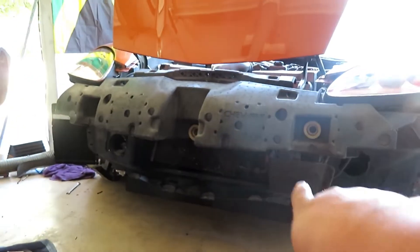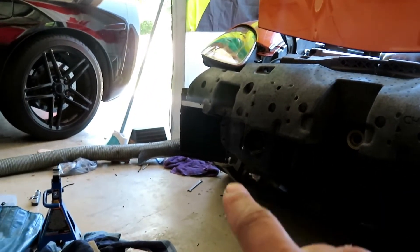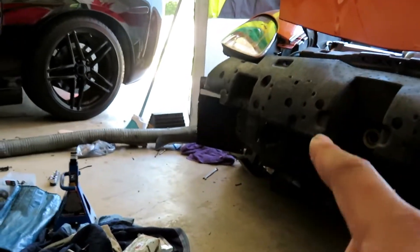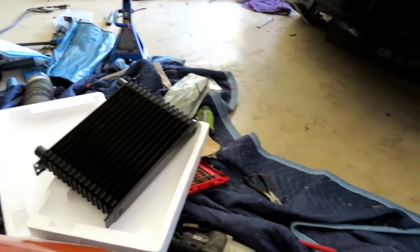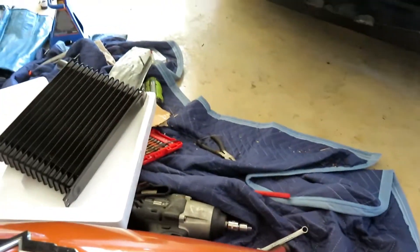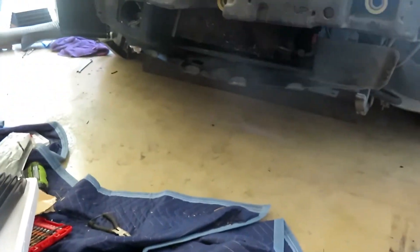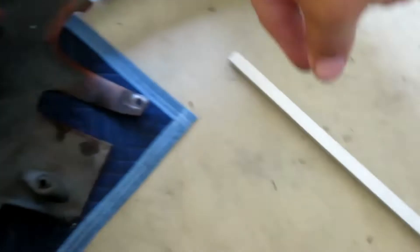The next thing I'm going to do is take that cooler off the front and start fabricating how to put that cooler on the other side, which is a lot smaller. Originally I was going to use a new cooler that just came in today, but it's way too big - the dimensions on the transmission cooler are 11 by 11 and barely fit; this new one is 13 by 11 and won't fit in any way. So I'm going to get my metal tubing, cut it to length with the circular saw, drill two holes for retention, and then start figuring out the cooler mount. First I'll take the cooler off and let it drain, then I'll start fabricating.